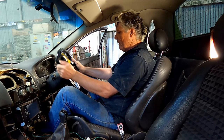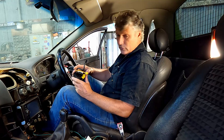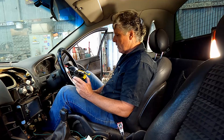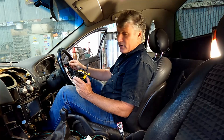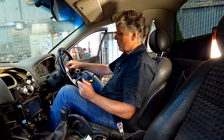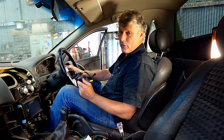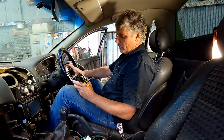This car had a new clock spring fitted not that long ago — they do fail. The little circuit breaks inside and things stop working, so you can come up with an airbag fault or controls that won't work. What actually happened when the airbag went off was it melted the plug into the back of the airbag, which killed that connection. GMH says to replace the clock spring, but I want to test it electrically — if it still turns and the circuit is working, there's no reason it has failed. If it's dead, I've got a replacement second-hand one.